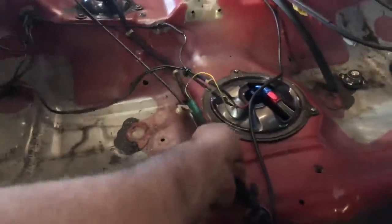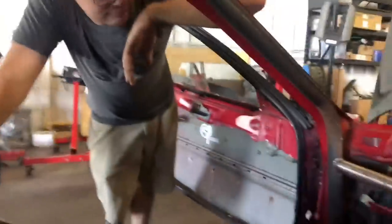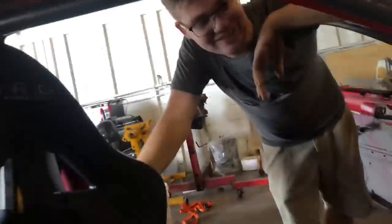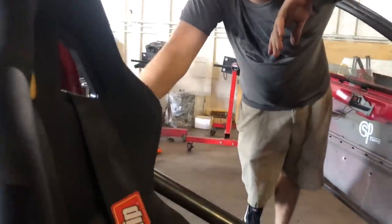We're gonna do away with all the stock fuel pump wiring as well. Instead of using the 14-volt fuel pump conversion off a relay like we've mentioned in past videos, we're also gonna do that off of a switch and an independent relay off of the battery directly, so we won't have to worry about the stock wiring. We're also gonna do away with the fuel level sender because it doesn't work on the cluster anyway. We're doing a five-gallon fuel cell eventually in the next month or two, and we're also gonna be doing a Windows tablet as a cluster connected directly to the ECU.